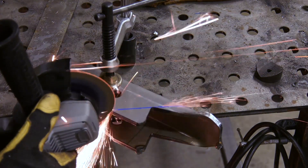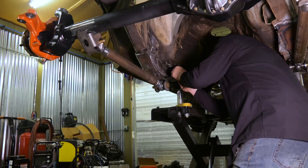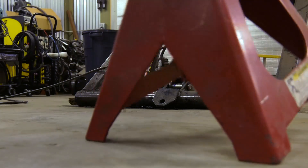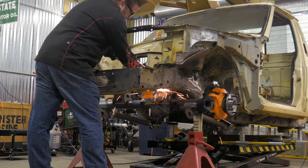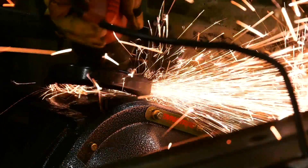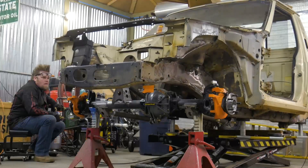The suspension may seem like it's about 90% done, but right now it's more like 50% done. The axles are underneath the truck — they're located. The rear four-link is done and the front three-link lower mounts are on. But if done correctly, you will spend more time figuring out upper link placement and panhard bar placement on that front three-link, because that's really, really important to how that suspension is going to react.